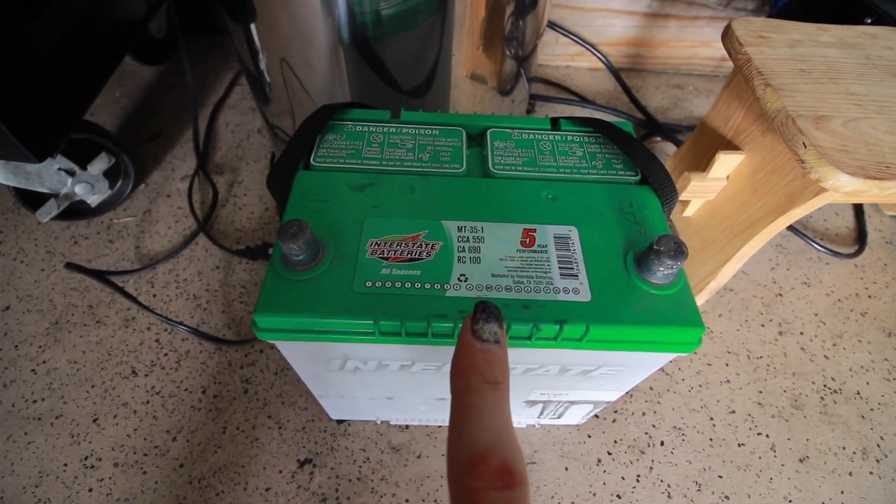So, I have a dead battery in the car. It is a fairly new battery, however it is dead, so what I need to do is get a new battery because this one is destroyed. It has zero volts in it, there's no saving it. I think it's got a bad cell, but I need to see if I have a parasitic draw that is causing this battery to die, because it was only like six months old. So I'm going to get a new battery right now at the auto parts store, and then we can continue troubleshooting and working on the MR2.